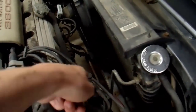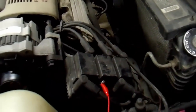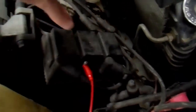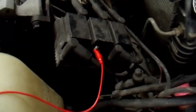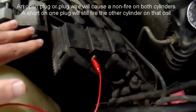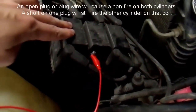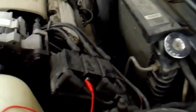I can just go through here and see which ones are firing and which ones aren't. If it's a bad coil, then I should be able to see that, for example, these two don't fire but these two do and these two do. Likewise, if all of them but one seem to fire, then I have a shorted plug wire or a shorted plug or something. I already know what the problem is because I already went through this — it only took me like five minutes. This coil is bad. Neither of these fire; all of the rest do. I'll pull them off one at a time and go all the way around.